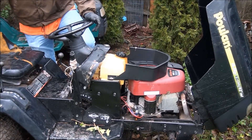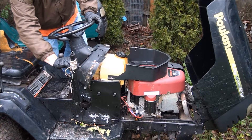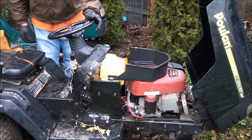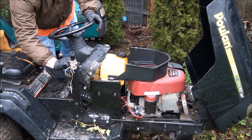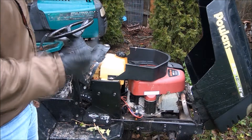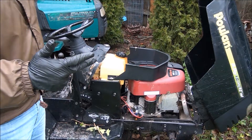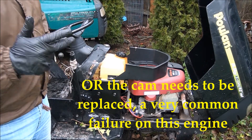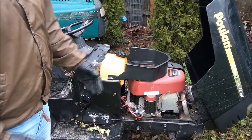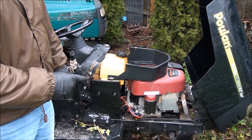Set the parking brake so we can start the engine without having to sit on it. See, it's just really tough, it's struggling. So when you have a situation like that, if you've made sure that the battery was good and that the solenoid was good and your starter motor was good, the valves need to be adjusted. If the valves aren't opening and closing exactly when they should, you're getting too much compression built up inside when the engine's trying to turn over and it's just struggling. So let's set the valves to the proper adjustment.